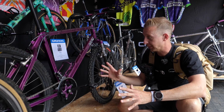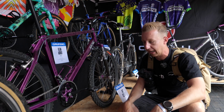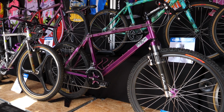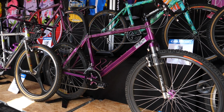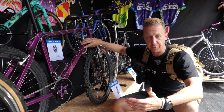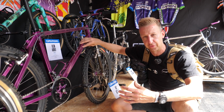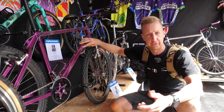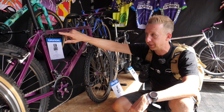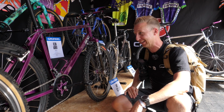So this really was a sort of childhood dream of a bike. The 100 and the 200 I've seen here, made by Pace Cycles, a North Yorkshire Moors-based company. Now they've got these, do you call it square tubing? Let's just call it tubing for argument's sake. On regular frame tubes you have butted tubing, so they will basically have areas with more wall thickness and less wall thickness to save weight and increase strength where they need to, so you might have triple butted or whatever. They do this on the outside of the tubing by milling away material, so that's essentially butting what these shapes are. But it just looks amazing, doesn't it?